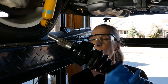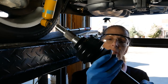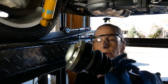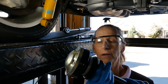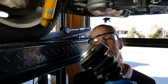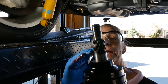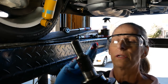I had mentioned I was going to rebuild the CV joints, but the boots actually look great — they're in great shape on both ends. I did replace the boots and rebuild these a few years ago, so it seems like a lot of extra work, and rebuilding CV joints is probably my least favorite thing to do. Before I insert this spline into the carrier, I'm going to put a little bit of grease on it — not a lot, just a little. It just keeps it from corroding, really.